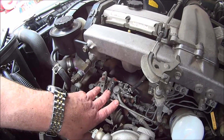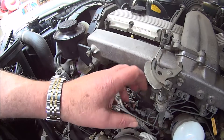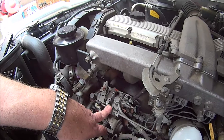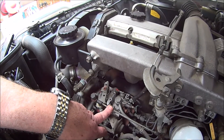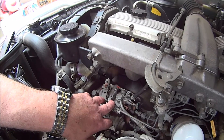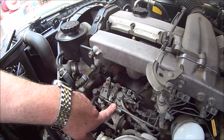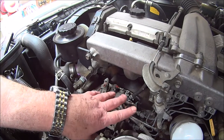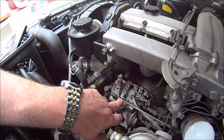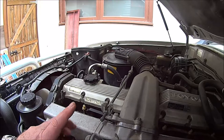In the case of an engine with a Holley carburetor, Holleys are specifically built so you can purchase different jet sizes, and if you work with it you can do quite well yourself. But to do a real top job — to know it's perfect — you should get the engine put on a dyno with an exhaust gas analyzer and get someone who really knows what they're doing to put the engine under all load conditions, through all rev ranges and driving extremes, and tune the fuel system accurately to the new exhaust system.